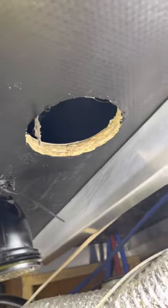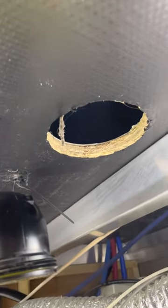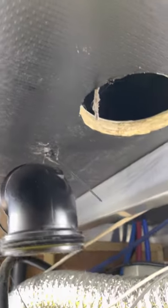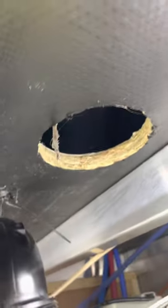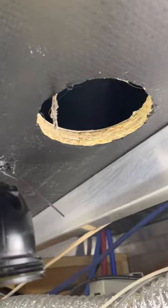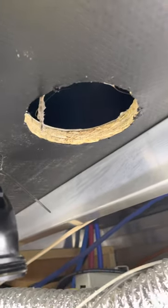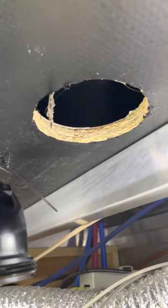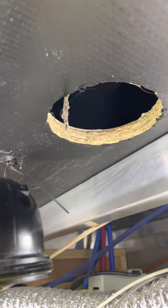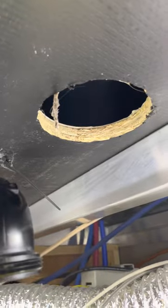The mounting nut for the drain was actually a little bit simpler. I was able to reach up in there with my faucet tool, put it on the nut with plenty of room in there to rotate. If, for some reason, you don't have the room, you can use a 2-inch socket and put a little extension on it and reach up in there and get it loose.